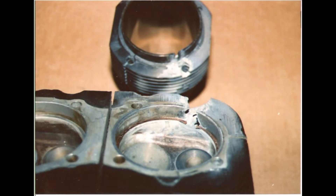This is what happens when a cylinder stud fails due to overheating. This occurred on a record run at Bonneville in 1974. Less than an hour earlier, I had completed my first run with an average speed of 175 miles an hour. However, the starter had held me up at the starting line with the engine running for several minutes. So when I started the run, the cylinder head temperature was already over 300 degrees. During the run the temperature kept increasing. When it reached 550 degrees, I backed off in order to save the engine. Even at reduced power, I was still timed at 176 miles an hour at the end of the third mile.